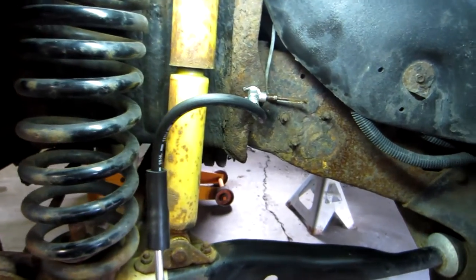That's why that brake hose is all shiny and new there. What happens with brake hoses isn't so much that they leak — some of them do, but most of them deteriorate on the inside and cause the hose to be a smaller diameter inside. It will push the fluid into the caliper and cause the piston to come out and push the pad against the rotor. But the problem is there's no force really pushing that back in the open position, so it's dragging. And that was the case here, so the brake hose needed to be replaced.